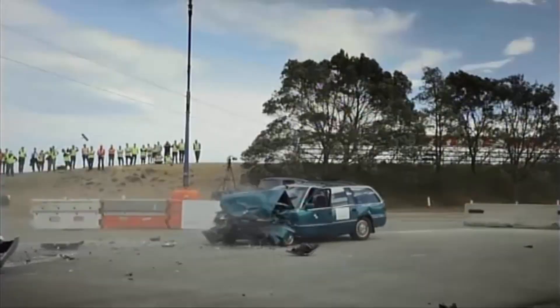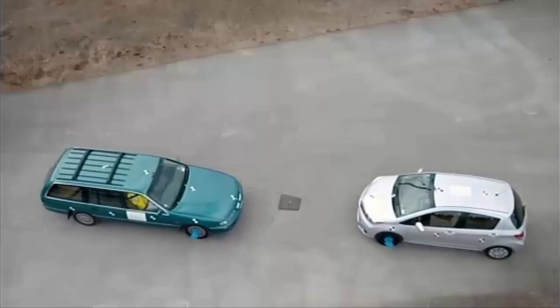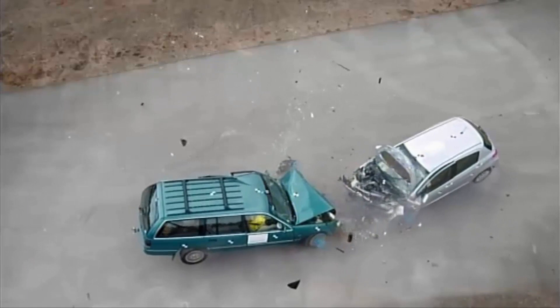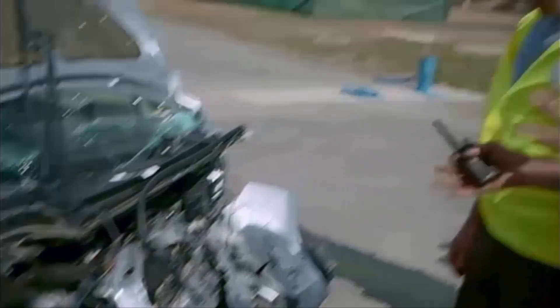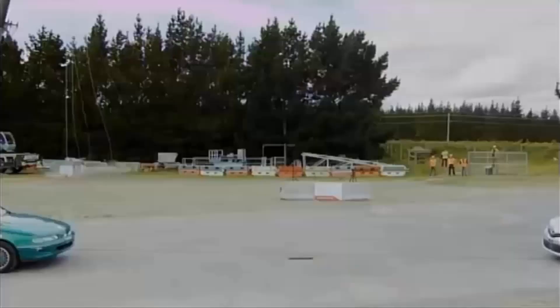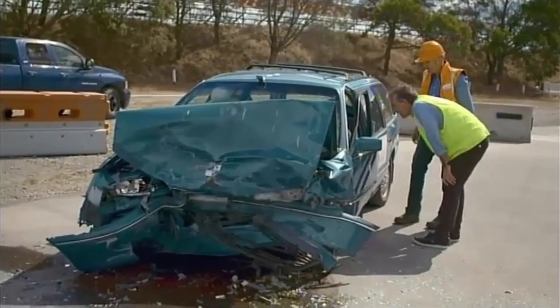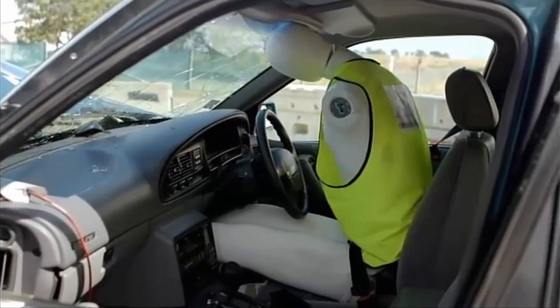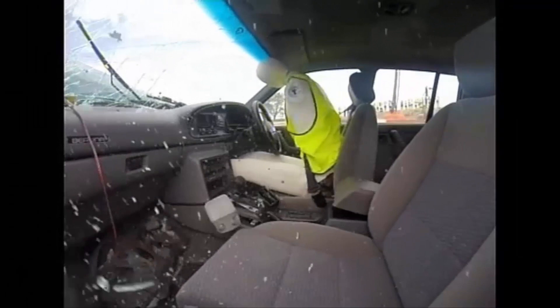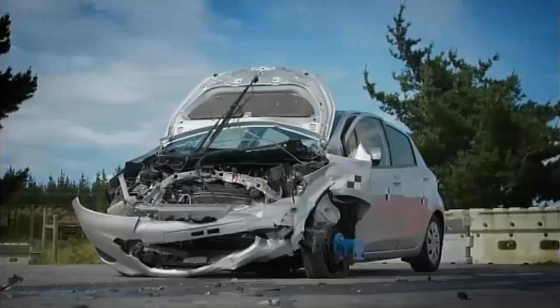Perhaps I should have attached some egg cartons to the Bellina, because the crumple zones on the Yaris exceeded my expectations. The Bellina is almost 50% heavier than the Yaris, so the Yaris had to absorb a lot more of the impact without passing it on to its occupants. You would think that thing hitting it would just destroy it — but it's exactly like we saw with those supermarket trolleys: the crumple zone absorbs all that impact, and all that airspace is squashed up. The severity of the punishment dealt to the Bellina surprised me. Although big and tough, the Bellina's got a glass jaw. Like all bullies, it can give but it can't take. Its lack of safety science means that its occupants have to absorb more of the impact in their bodies than their counterparts in the Yaris.